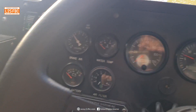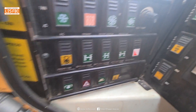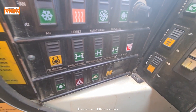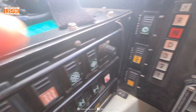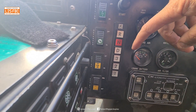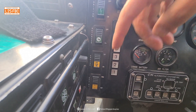The vehicle weighs about 12 tons unloaded, or as it is now, 15 tons maximum GVM. Here are the differential locks — center, rear, and front cross-axle differential locks — just as you would in a normal four-wheel drive. Each can be operated independently. It's an automatic transmission; you press those buttons to select a gear, and same as a normal four-wheel drive, you'd select first for coming down a hill.